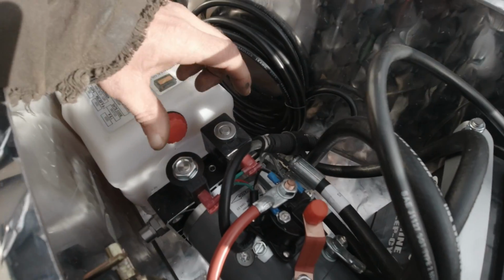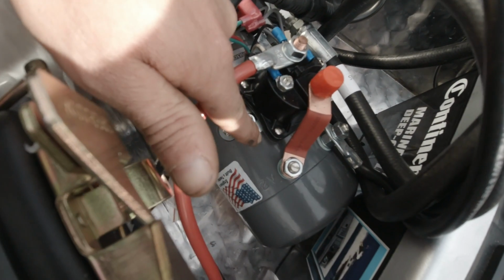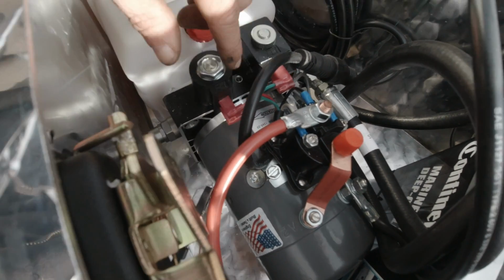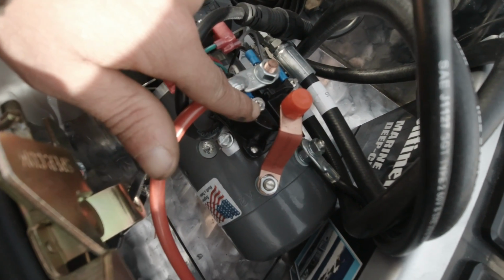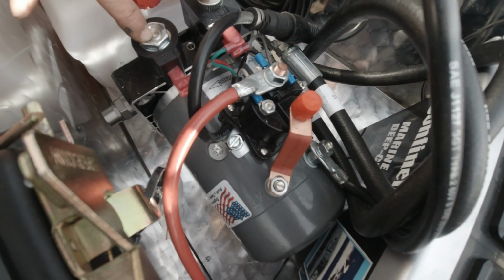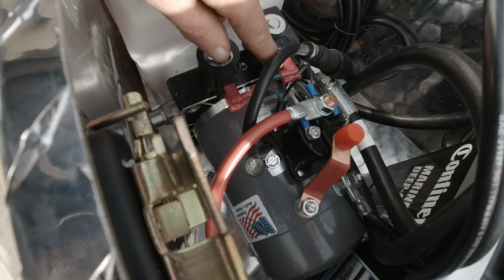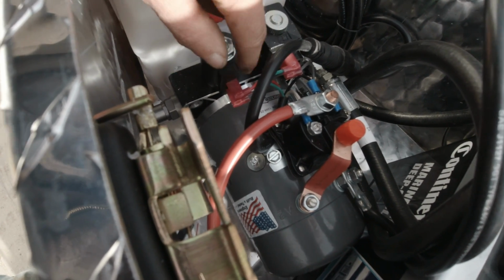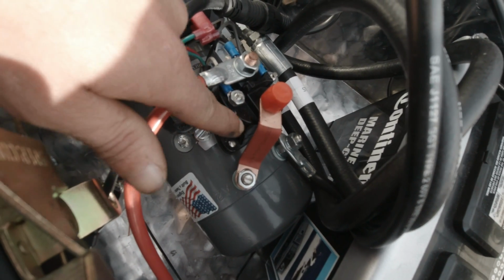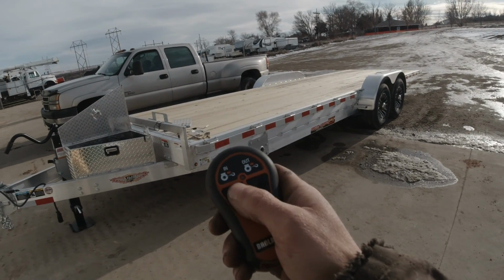So now on the pump side of things, we have this relay that turns the hydraulic motor on and off, and then we've got these 2 solenoid valves. Basically, that wire that we wired is going to go to the relay for the motor, and then the other 2 are going to go to these solenoid valves. Should be the top red and the green here that control the solenoid, and it should be this white wire here that controls this relay. Oh, yeah, to keep this one short and sweet, really that's all there is to it.